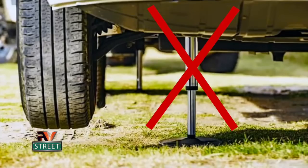Number two — having a perfect or almost perfect level makes RV living a whole lot nicer and it's good for the RV. You don't risk twisting the chassis, you don't bind the slides, and your absorption refrigerator will love you. Number three — when leveling your motorhome, never bring the rear tires off the ground. That's where your emergency brake is. Even though you see people raising the front end way up with tires off the ground, it's a horrible habit. Leveling jacks are not lifting jacks — they're leveling jacks.